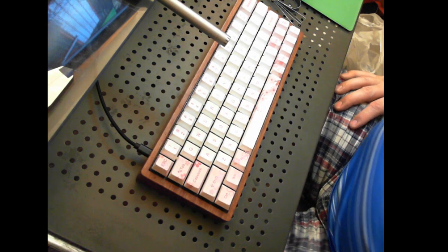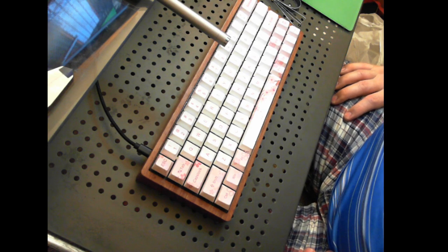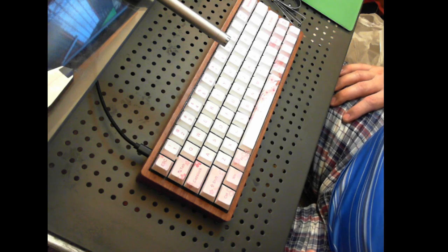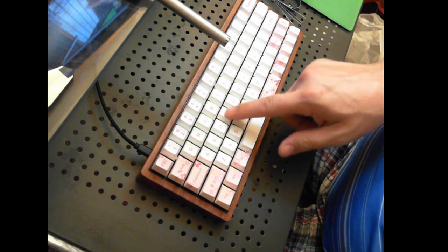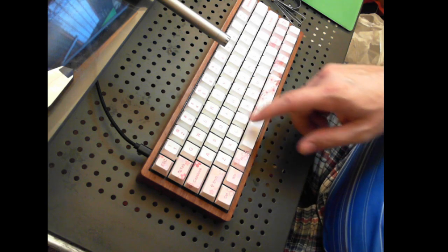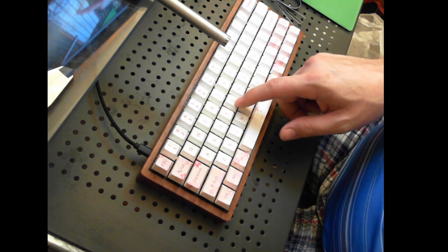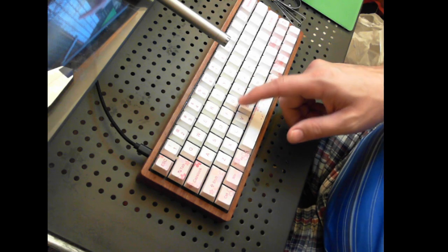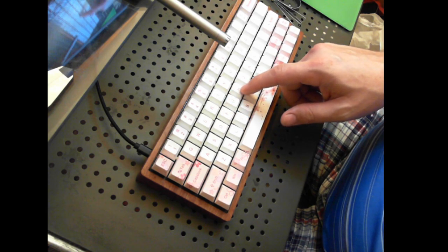Interesting. So, to my ear, the sound of all five switches is greatly improved by the lube. They all sound pretty good to me. I still prefer these three, which are the Outemu no slot top, the Revo White slash Gateron Milky top, and the Panda top.